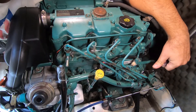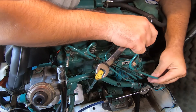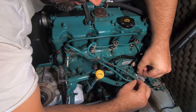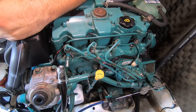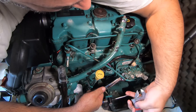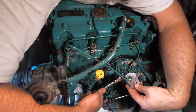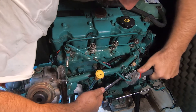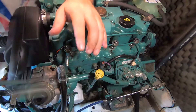Remove the clamps from the fuel supply pipes and then remove the fuel supply pipes. I started by just cracking the nuts on each end so they were finger tight, then undid them completely and lifted the rail off all in one go - this reduces the chance of bending the pipes. Cover each end of the pipe with a rubber finger as well as the ports on the injection pump. I ran into a bit of a problem here: the fuel supply pipe was actually being bent because the nut on the injection pump and the nut on the fuel supply pipe had become seized together. I counter-held the pair of them and gave them some curry - one more time with passion - and Bob's your uncle.